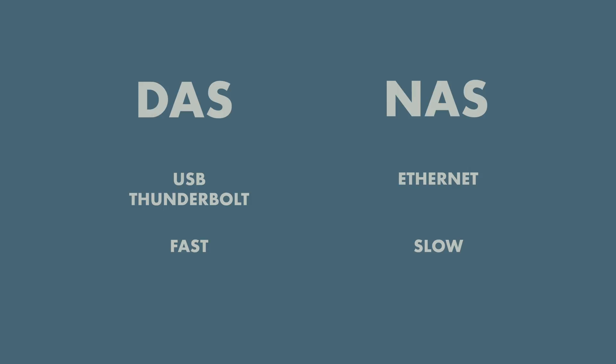Having a storage system that allows you to store all your files in one location makes for a much better workflow. If you're in the creative business, you know well enough that tens or even hundreds of gigabytes can be consumed by only one project. For years I was storing my files in multiple drives, but at some point I wisened up and went the DAS route. There are also NAS systems that do the same thing, but the speed is lower because NAS drives are connected to your computer through Ethernet, as opposed to USB or Thunderbolt for DAS systems.